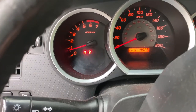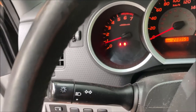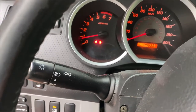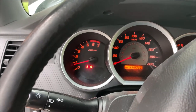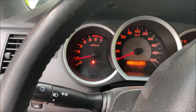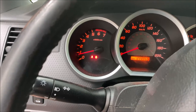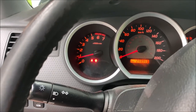It's been about five minutes so I'll wait a few more. Re-hooked up the negative battery cable and started the truck — had to let it warm up because it'll sit at high idle for a few minutes otherwise. Idle is nice and smooth, idling around 750-800 RPM. This is a five-speed manual; if it's an automatic it'll idle a tiny bit more, but around 800 is where it should sit. Turned on the AC and it idles up to about 900 — AC off, it's perfect.